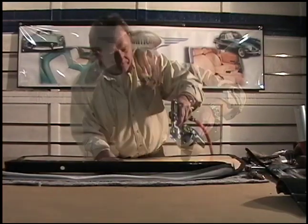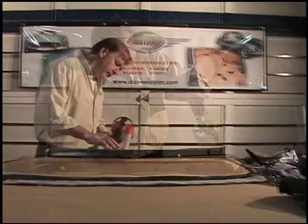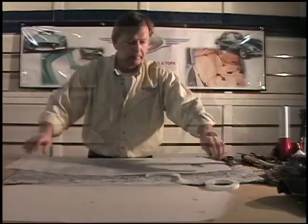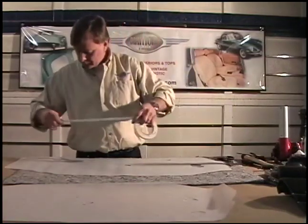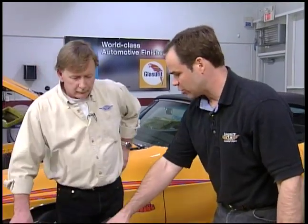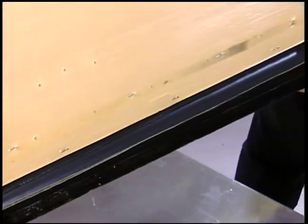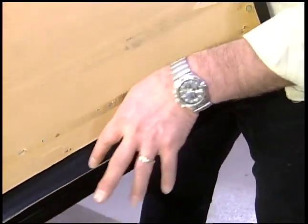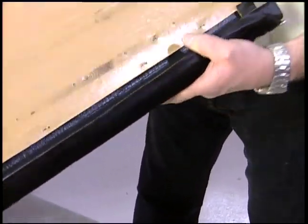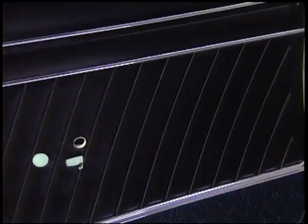That would require breaking them off of the panel board, cleaning them up, painting them, removing all the anti-rattlers, and installing them onto the unassembled panel. Now, an original panel would come with steel, and one of the pre-assembled panels would come with a plastic insert. For concours quality, you prefer the steel panel — absolutely, go with the steel. The radius on the top of the panels is very important for keeping the panel tight to the seals on top of the door. With metal in there, they tend to last a little bit longer, look better, and are a little more rigid.